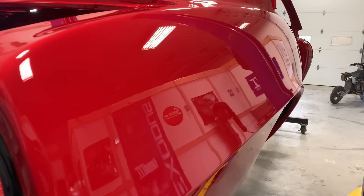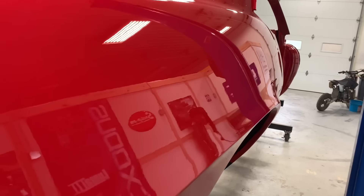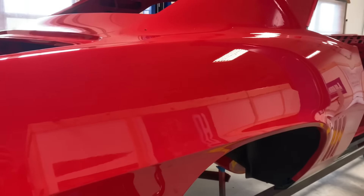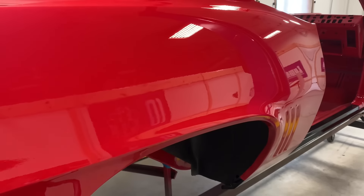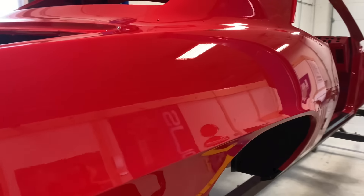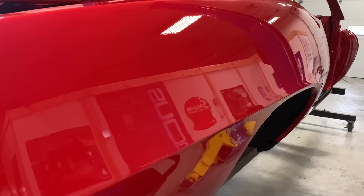What we're going to do is block one quarter with a linear block and one quarter with a foam block. As you can see, the bodywork is very good on these — they're straight. This clear has been drying for about three weeks now, so now it's time to start cutting it open. You can see it's got a very slight little ripple in it, and that's what we're looking for before we start cutting. We want the clear to be nice and hard. This is a perfect example to use for this demonstration.